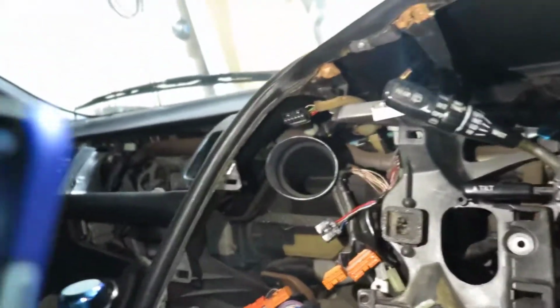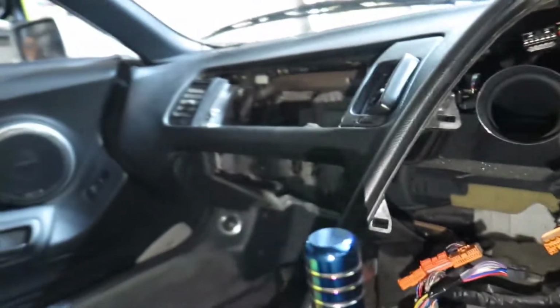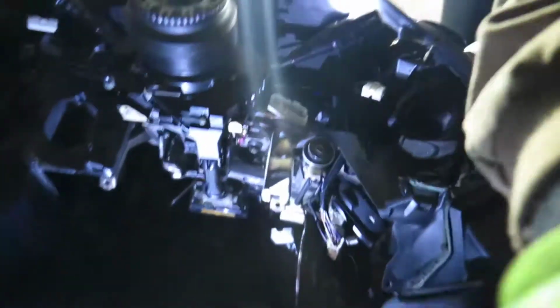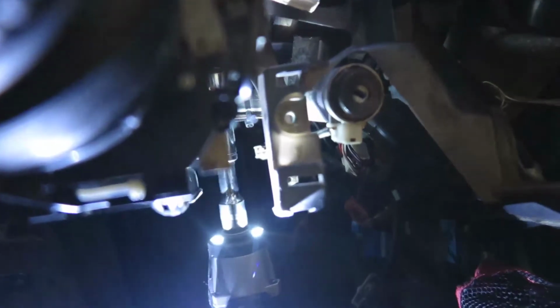And yeah, that's the beauty. What we need is right down there. So yeah, two more things. Gotta drop the column because this won't go through, right? And might need to take this here down too. So the column, if you look down here, or up here, you see two funny things like sandwich stuff, and there is a 14mm on the bottom. So I'm taking that 14mm, took the steering wheel, as you can see, and there you go, right here I have my impact.